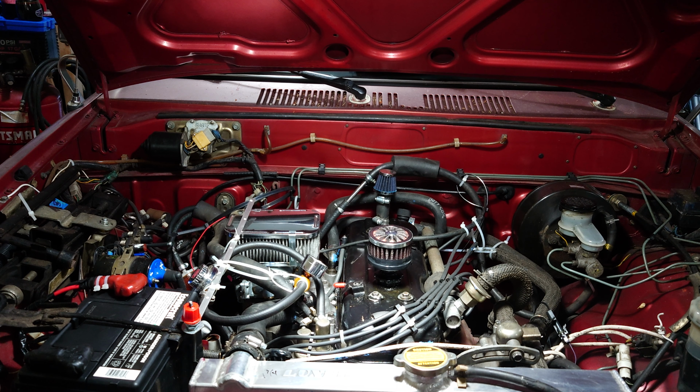I've never torqued head bolts by loosening the head bolts after they've already been torqued and then retightening. I just keep tightening them down. And you want to make sure that you do it in the proper torque sequence also.